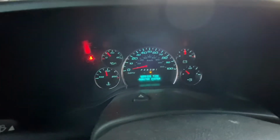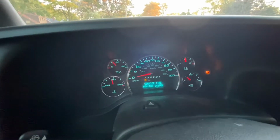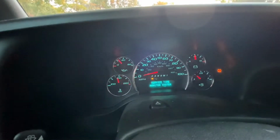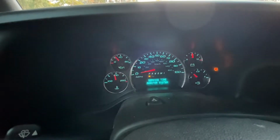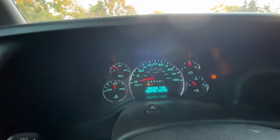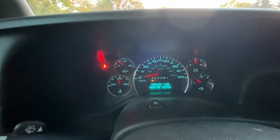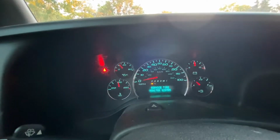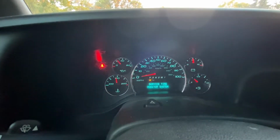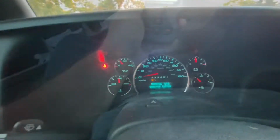So far nothing. What I've read on this is that the brake light switch, which I'll show you is under the dash here at the brake pedal, usually is part of the problem. Usually also there are some other issues that come, which are misfires, but we don't have those. We're gonna put our tester on and we'll see what codes we're getting, if we're getting any codes.